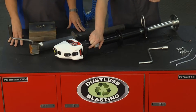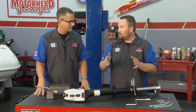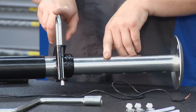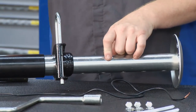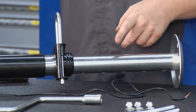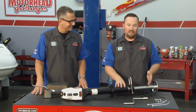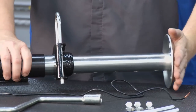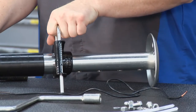We have lights integrated into the unit — one forward-facing to help you line up your trailer at night when you're backing up, and two rearward-facing. If you run a weight-distribution-style hitch, you're going to use those lights at night to help hook up those spring bars. My favorite feature of this whole thing is the spring-loaded plunger pin. When you pull up and get ready to use the jack, you pull the pin out and the foot comes out — the longest foot in the industry — so you won't have to have your wood blocks around anymore.